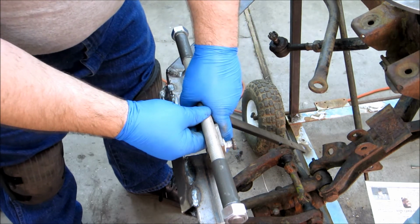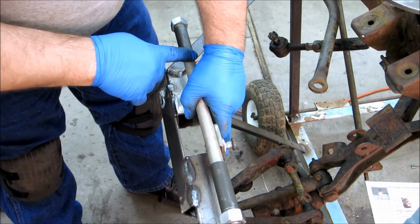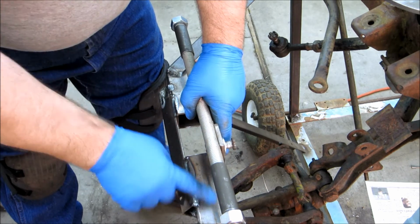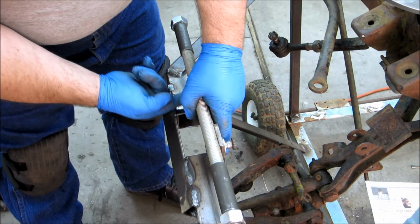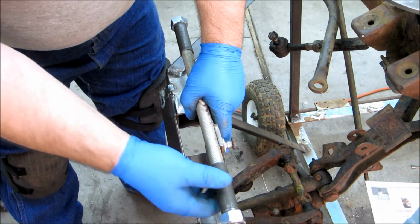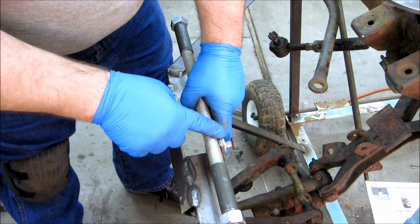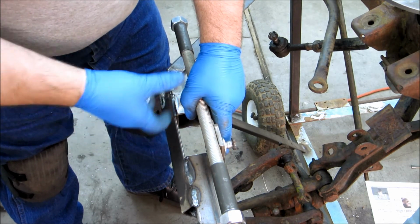That would be fine. Anyway, what's going to happen here is once this is welded on here, I will also weld supports down here. So these tubes will be rigid and mounted to the jig out here. Then I can basically cut these off right here, and they will rotate on this bar. Now this bar, the tube here, hardly has any slop in it at all, and once I put a couple of nuts in here, then these pieces will stay in this location and be able to rotate freely. So once I bolt the hub to it, they'll stay rigid together.